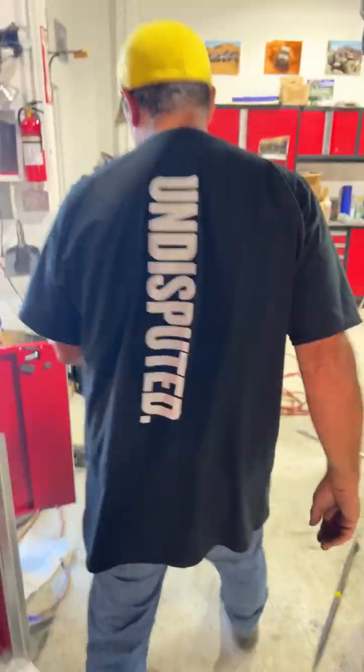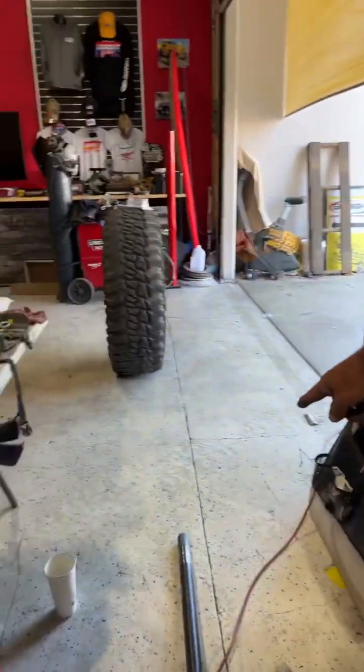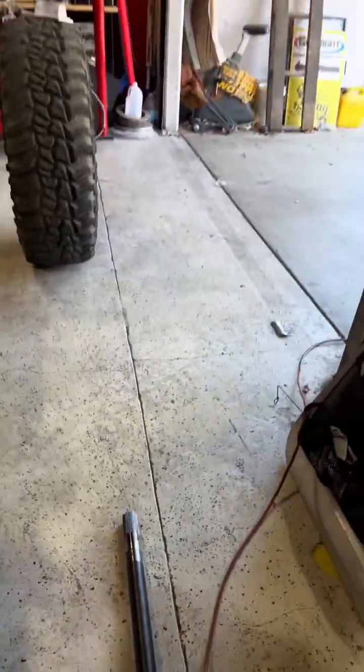And then while we have the shafts out, because we pull both sides, we're inspecting the splines to make sure that they're not twisted. So actually they look great. Both the shafts look like brand new. So that's good. But this is the routine stuff you need to be doing to make sure that your vehicle is really... Well, it's almost hammer season, right? Almost hammer season. Is there anything tougher on your vehicle than that? No, by far the toughest.